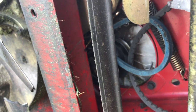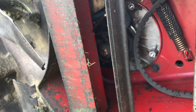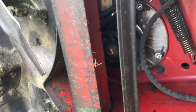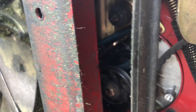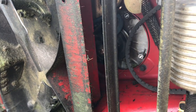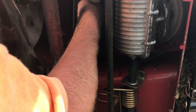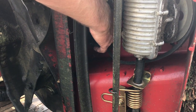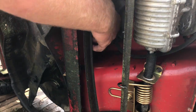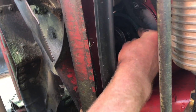You want to flip the mower up this way so the exhaust is down on the bottom — you don't want to flip it up the other way. I've got it over this pulley. You have to get the belt over this pulley here and stick it around the second pulley. So it goes on the pulley closest to the top of the deck.